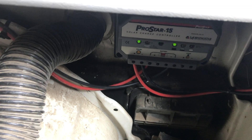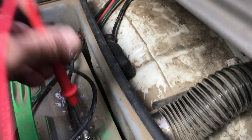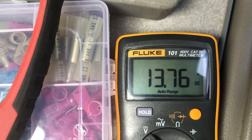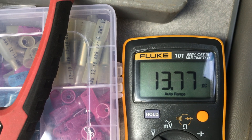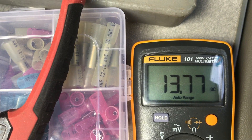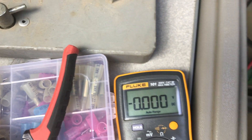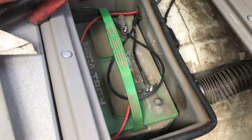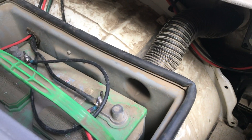We're making voltage. Hook up to the battery — let's see if I can do this with one hand here. And there we are, we're making alternator voltage: 13.76. So we're charging, it's working. Next thing is I'm going to replace this battery and move forward to the next project. Thanks for watching, hope you enjoyed it, and hope this helps.